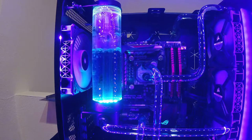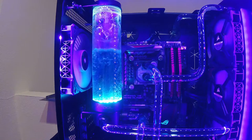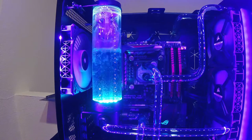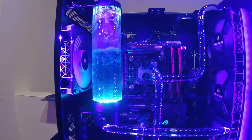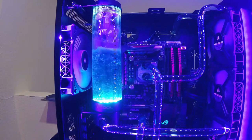What will happen at higher speeds is all those little bubbles will find a place to hide — like in your radiator or maybe in one of the water blocks on your hardware. They can collect and grow into a larger trapped air bubble somewhere in the system. If you have no speed control and you're running your pump at 100%, it's significantly louder and you can see all the air this is putting back into your system. It's not a great solution.